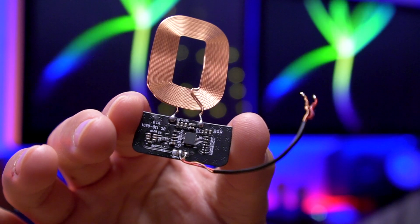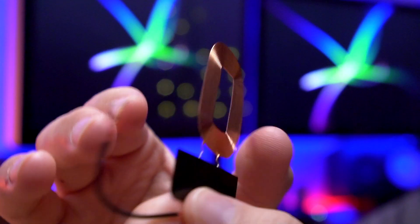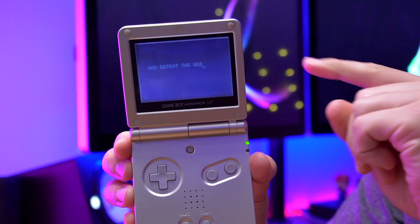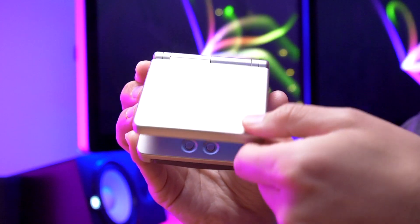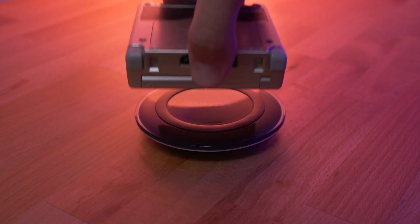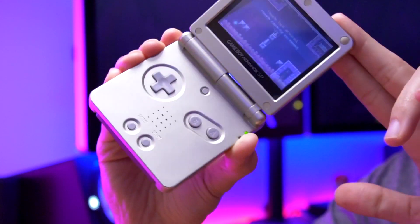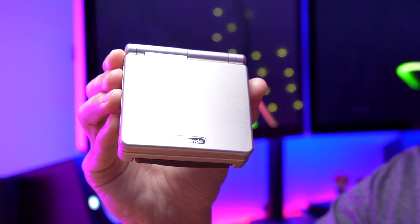I'll first go over all the parts you need to do this mod and I'll have links in the description below if you'd like to purchase them. The first thing you're going to need is this Qi standard wireless charger receiver module. This one has about 5 volts of power output, which is more than enough to charge the Game Boy Advance SP. It's also fairly thin so hopefully it'll make placement easy. The reference reddit post put the wireless receiver module in the top half of the console behind the LCD. While it may be easier because of the available space there, I'm not a huge fan of laying the console upside down to charge it. My goal is to place it on the bottom half of the console so we can have it right side up while charging. The next thing you'll need is your Game Boy Advance SP — this is a completely stock AGS-001, but this mod will work for any SP model, even if it's modded with an IPS display.